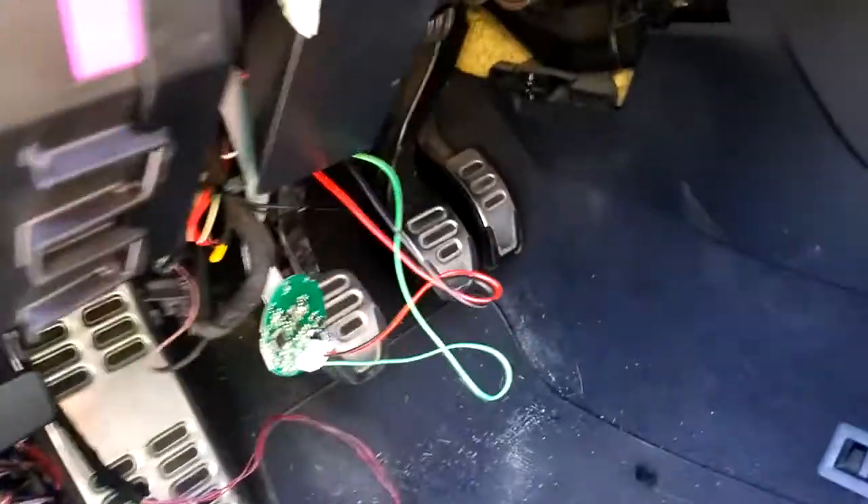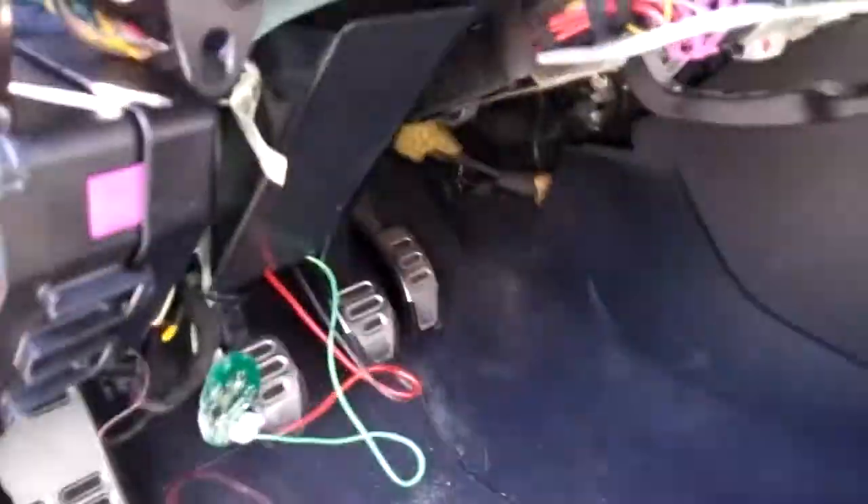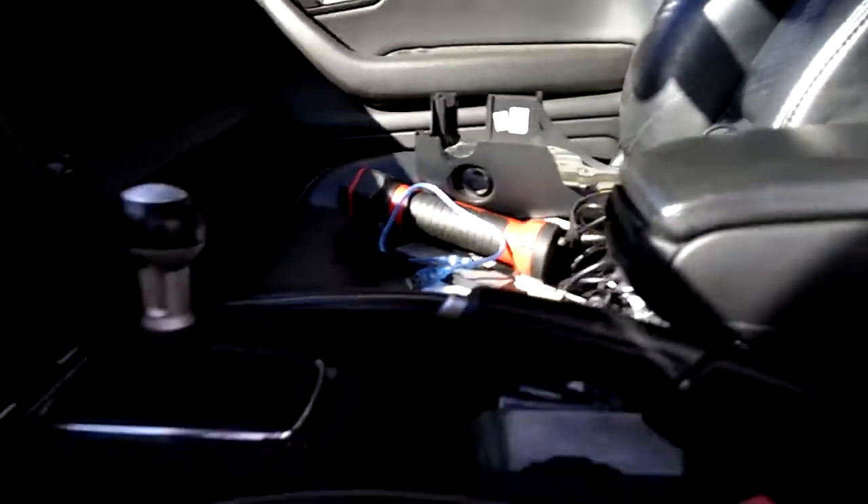I have lots of these things lying around with very little use for them, and this is all low-current stuff, so no issues. I've run it through the steering column here, so no issues with the telescoping column. The wire has to come out of the front of the switch here — that's the only spot where there's lots of room around the shroud there that covers the bottom of the steering column.